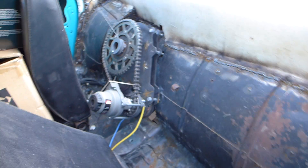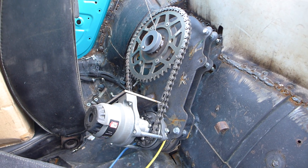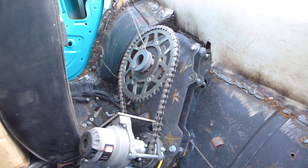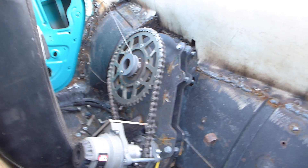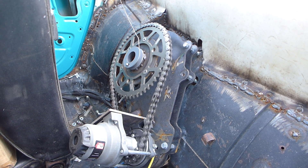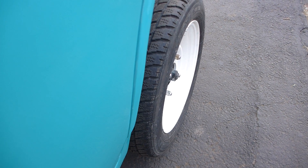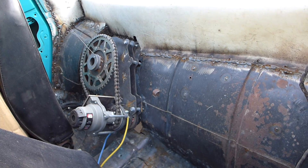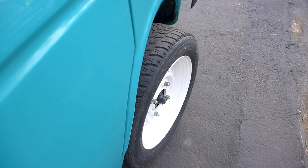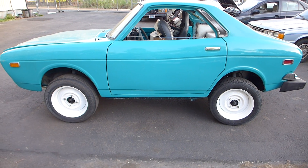What's really interesting about this car is in the back seat. Let me pull the seat forward so you can get a better look. There's an electric winch motor on the bottom, and it uses a motorcycle chain to drive a steering rack. When you're driving the car, it turns the rear wheels. So you can crab walk, you can do crazy cookies, you can do whatever you want.